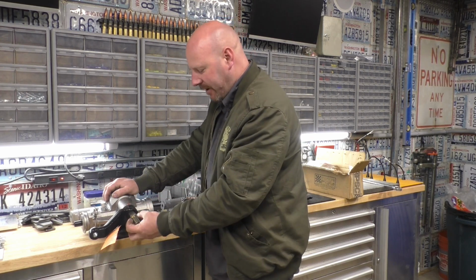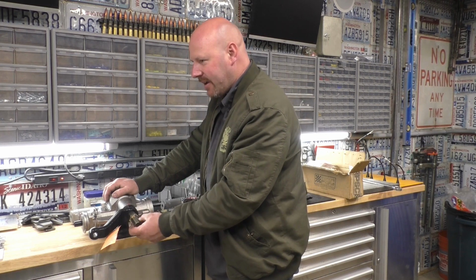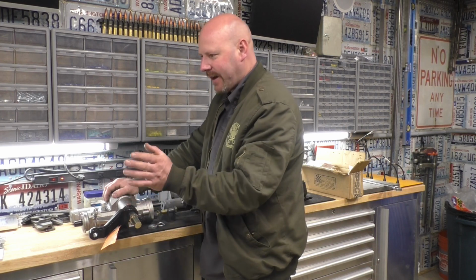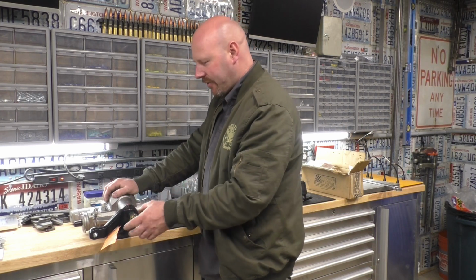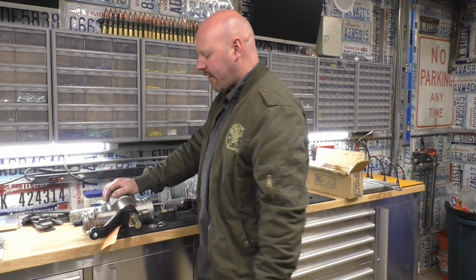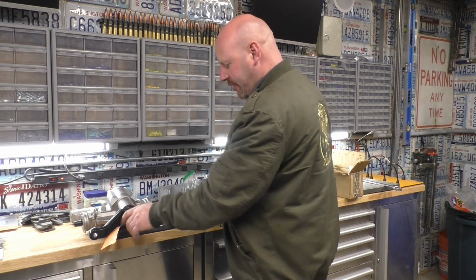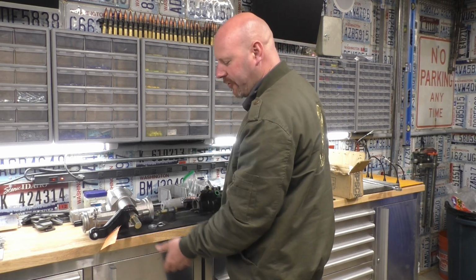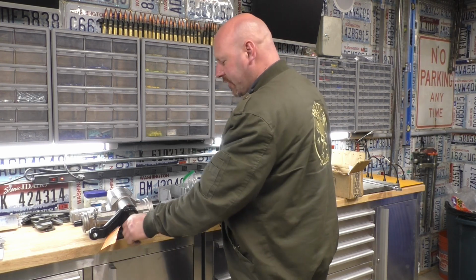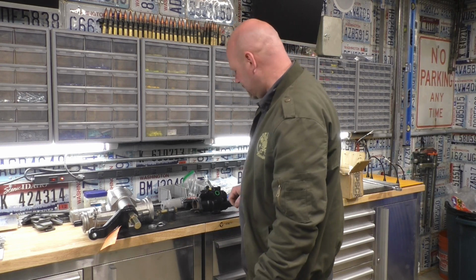I have some custom bearings that I use on gates that I'm going to use, which is an industrial sealed spherical bearing. It's good to a ridiculous amount of weight, like 100,000 pounds or something like that. I'm going to incorporate that into ours. But there are other options. If you were to buy a kit, it would most likely just come with a 2 bolt flange bearing, and that works good too. Those handle more weight than you'd probably ever put on them in an off-roading situation anyway.